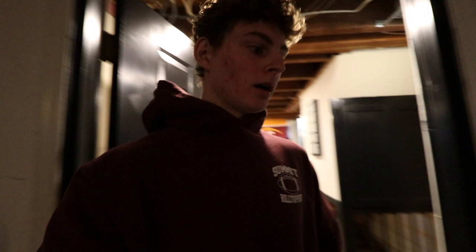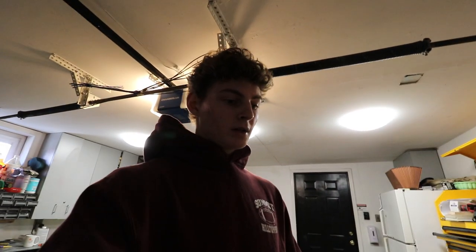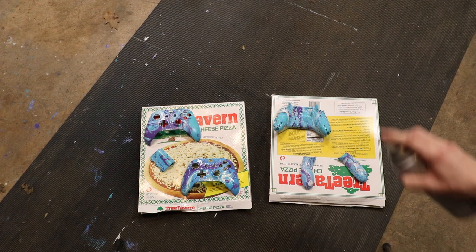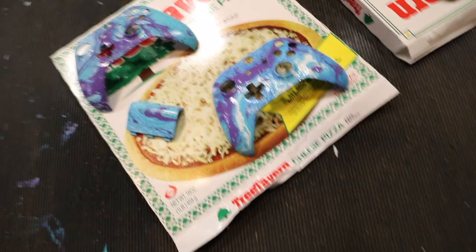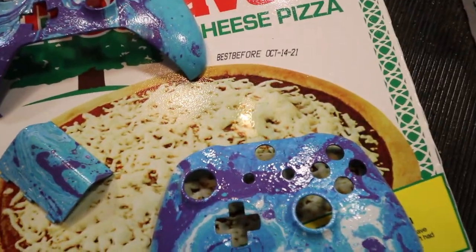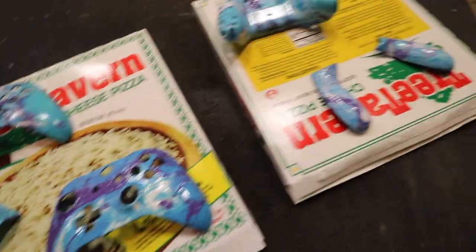It's the morning time right now and we gotta go put on the clear coat. I already actually put on two clear coats already, so I'll show you guys how to do it — very light at the beginning. I'm gonna put mine a little bit more heavy because I already have two coats on it, so this is gonna be the last one. That's the last and final third coat. It's a little bit shiny and runny there, but that's all right. For the first two coats, I would suggest doing 20-minute intervals — do the first one really light, the second one decent making sure you cover everything, and then the third coat a little bit heavier. Then I would suggest leaving it for almost 24 hours, or at least five to seven hours. Just keep checking up on it and make sure that it's dry.